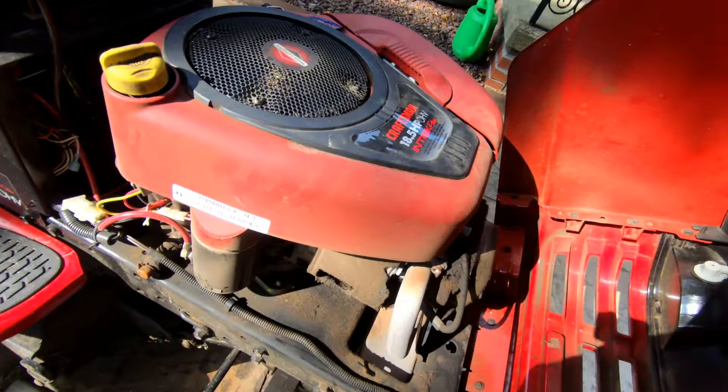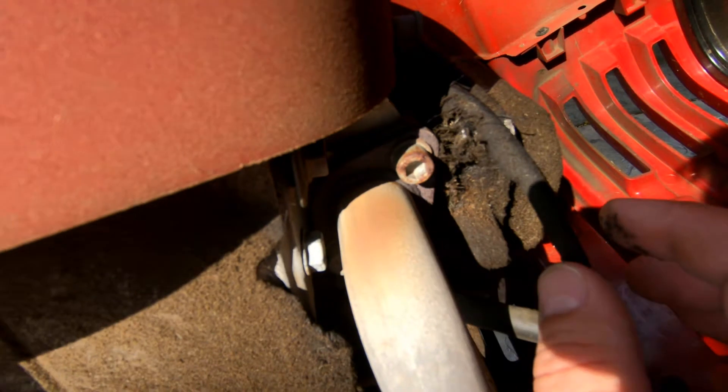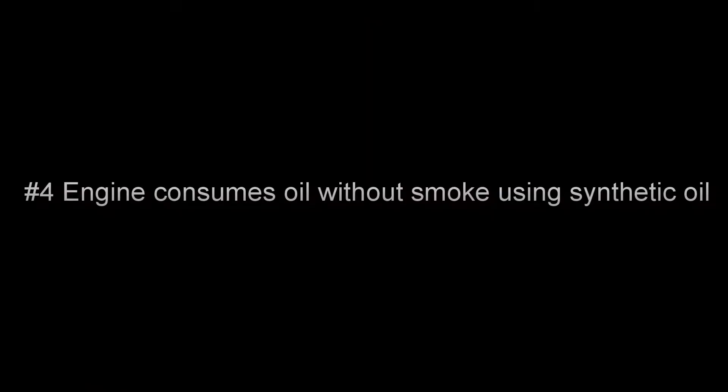The third item is your engine has oil all over it, blocking the cooling fins. There's pressure in the crankcase, and somehow it has worked its way out and deposited oil all over the engine. This is actually what happened to this DYT-4000 — it runs good, it starts good, but there's oil everywhere and the grass just stuck to it, clogging the fins. I use synthetic in virtually everything, and this model actually consumed oil but never smoked whatsoever.